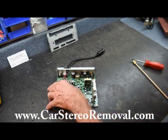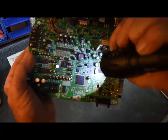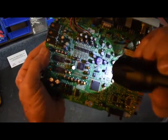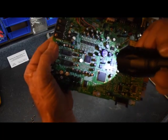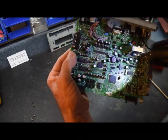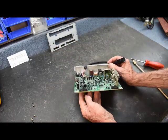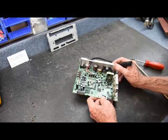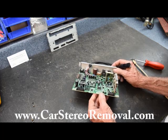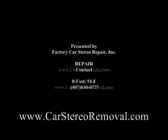We've gone through and cleaned this board up. The resistors have been soldered back in, and the transistor is back in. I have a jumper wire in there that goes from the top of the two resistors over to the transistor — you can't see it, but it's there. This is what takes care of the hieroglyphics problems with the Subaru Outback and Legacy stereos. If this video has been helpful, please give a thumbs up. Email questions with your question in the subject line. Please subscribe and thank you for watching.